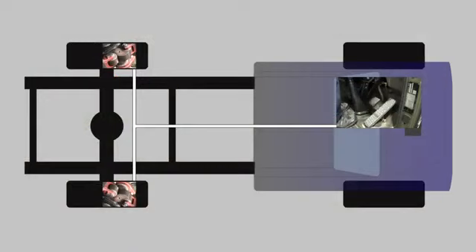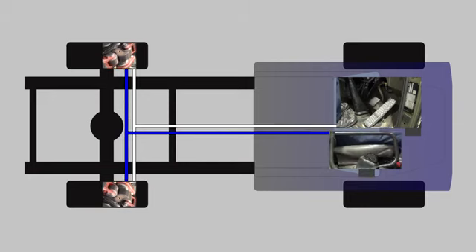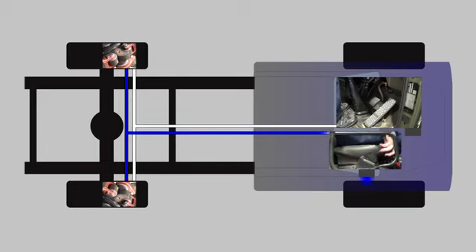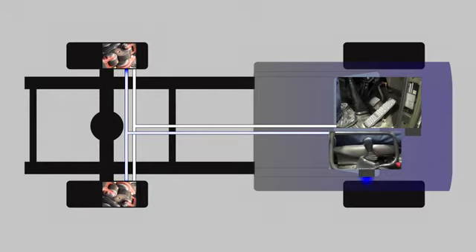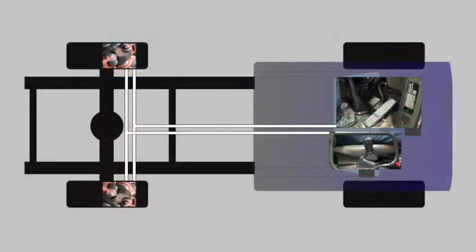Let's now put the secondary and parking brakes in and see what happens there. To apply the park brakes, the driver operates the hand control valve, which exhausts the air from the secondary circuit allowing the power springs to apply the brakes. However, with a delay between applying the park brake lever and the park brakes actually coming on, if you wanted to apply the park brakes in a hurry, you'd have to wait. Let's rearrange this system with some quick release valves and see what difference they can make in speeding up these laggy brake operations.